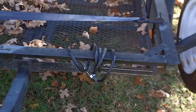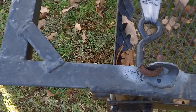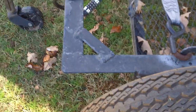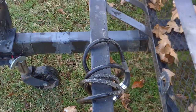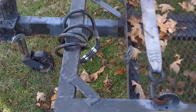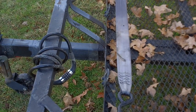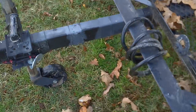In the front of the trailer, because it wasn't long enough for my four-wheeler, I extended it out to the front. All I did was cut it and extend it out — I've got bracing right there. The reason is the front wheel comes up so it gets the weight far enough forward that the four-wheeler fits on the trailer, and it stops trailer sway. When you have a trailer, you've got to have a little more weight on the front than on the back — that's how you stop trailer sway.